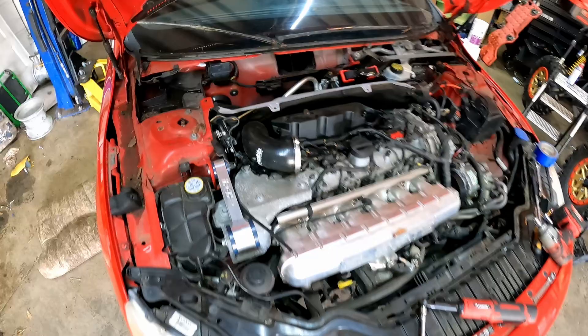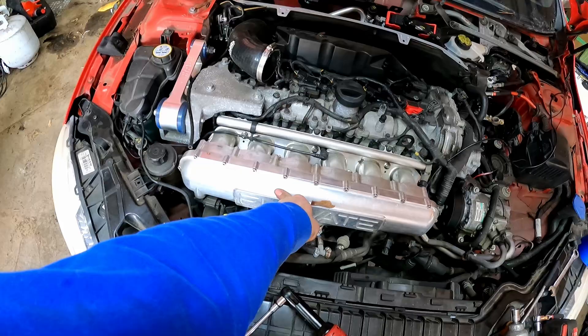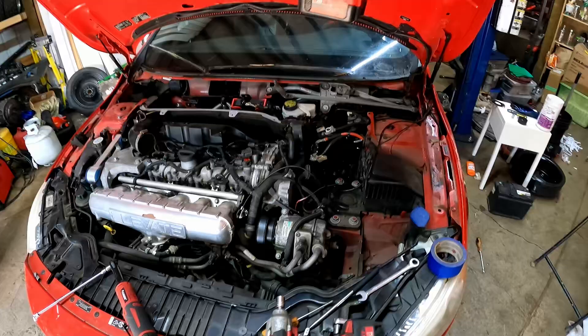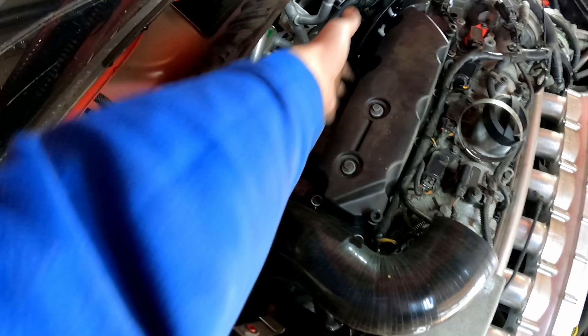I did say I'm gonna remove the intake manifold. I may actually do that too. I'm gonna have to remove the fuel rail, and I may have to lower the engine so I'm gonna have to loosen these three bolts here to do that. Alright — so we got the fake firewall off, and you can see I can see the turbo, I can see the downpipe. There are two sensors. I have full access here. I can do the oil trap.